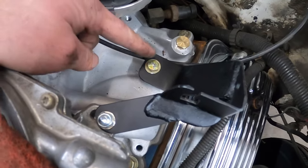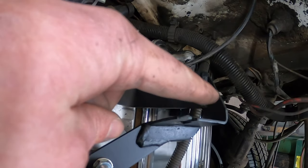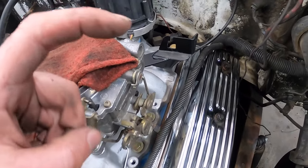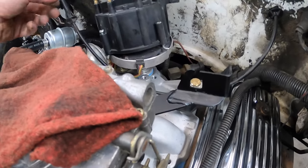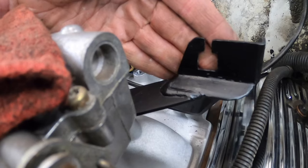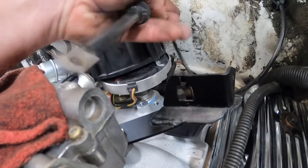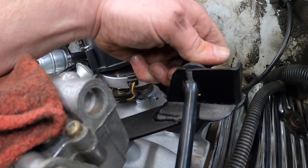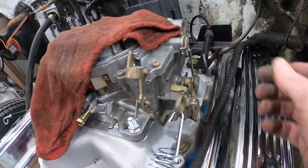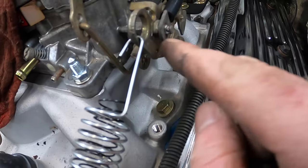Just like that, we have a throttle bracket. It ties in right here at the intake like we talked about — simple little 45-degree bracket, chopped-up bracket there, welded up. Bracket here goes over, welded top and bottom, a little rattle-can powder coat while it's still hot. You could have made a whole new bracket from scratch, but to recreate this perfect square hole is too tricky for this particular truck. So we just thread the cable through here and give it a snap in. Then we move up here to the carburetor and slide it over the little stud.